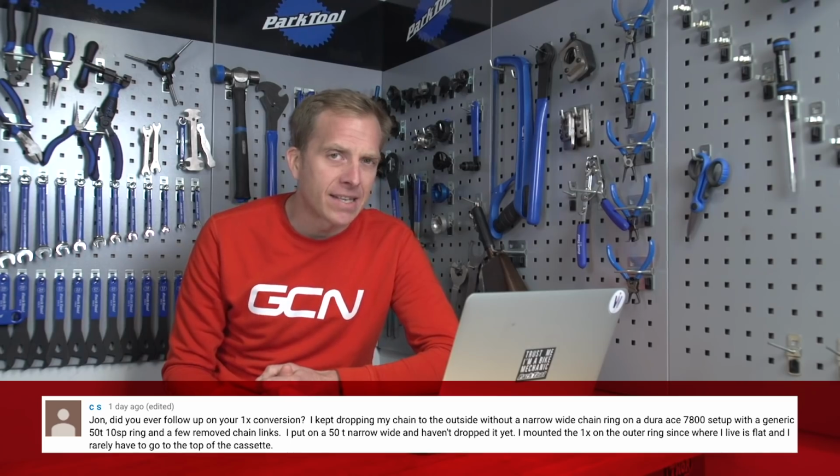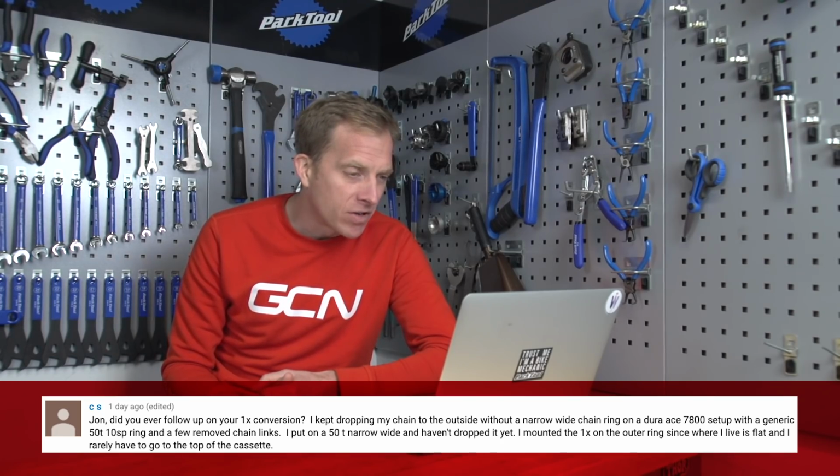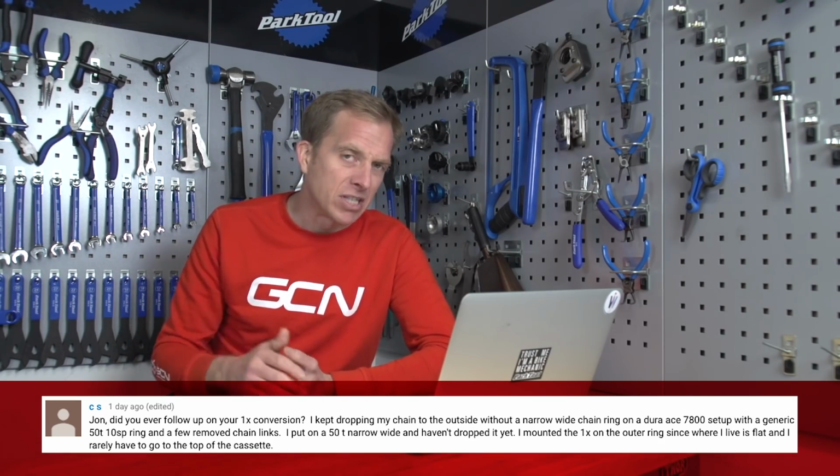Next we've got CS. CS, they pop up from time to time in the comments. Good to see you again. "John, did you ever follow up on your 1x conversion? I kept dropping my chain to the outside when I wasn't using a narrow wide chainring on a Dura-Ace 7800 setup with generic 50 tooth 10 speed ring and a few removed chain links." However, CS then put on a 50 tooth narrow wide chainring and they haven't dropped it yet. They mounted the 1x on the outer ring since where they live is flat, and they rarely have to go to the top of the cassette, so the really low sprockets there like the 32 or such like.